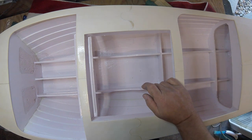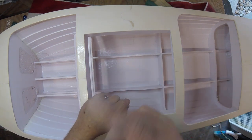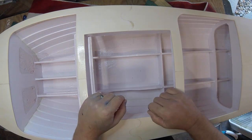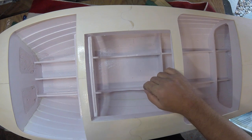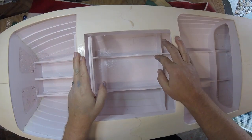The nice thing about using it as a sealer is you don't have to spray it perfectly because you're going to be sanding it anyway. If you get a run or two, nobody cares — it's not your top layer of paint, it's a sealing coat. For instance, I shot it yesterday, let it sit 10 minutes, shot it again, let it sit 10 minutes, shot it again. It took me a couple hours, and then I just let the whole thing bake. It's nice and sealed.